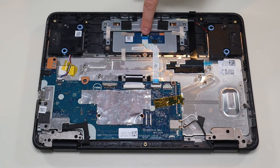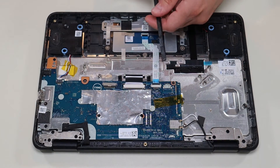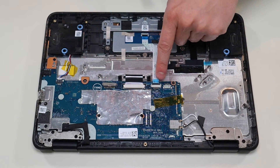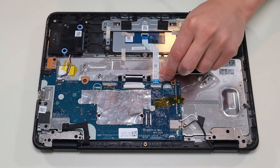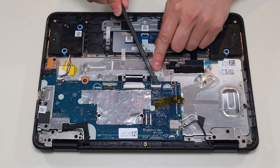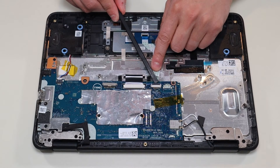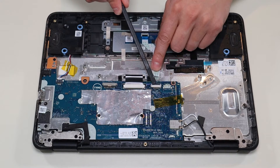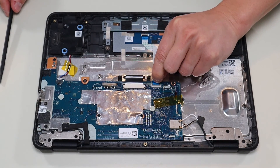This is your touchpad assembly down here. This is your touchpad ribbon cable that comes up and plugs into your motherboard. After unscrewing these three screws, that will release this metal guard, and then three more screws will release the plastic one so you can get your touchpad up. To unplug this type of ribbon cable, you'll need a small flat plastic pry tool. That black clip holding down the ribbon cable — put your pry tool under it very gently and pop it up so the ribbon cable can come out. Be very careful with that black clip; if you break it you probably won't be able to find a replacement and the ribbon cable won't secure correctly. It opens like a book cover on those gold or brass hinges, so be very careful when popping it up and equally careful when putting the ribbon cable back in.